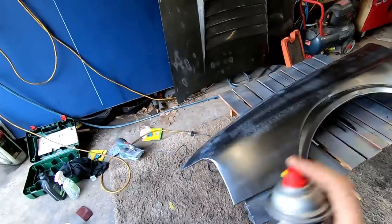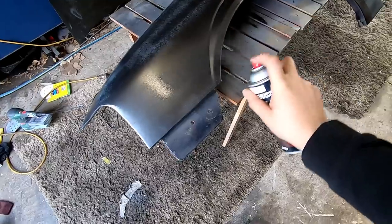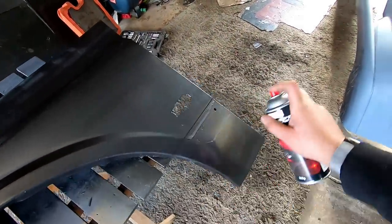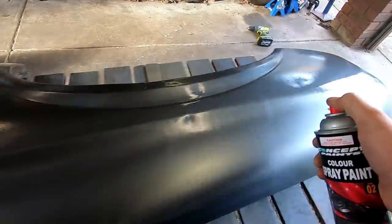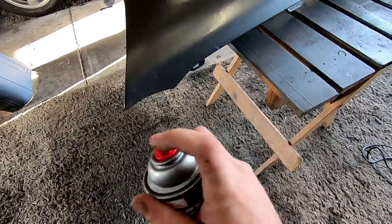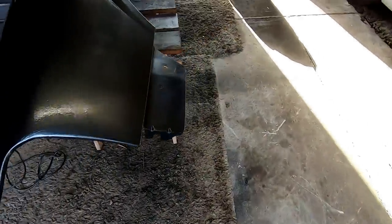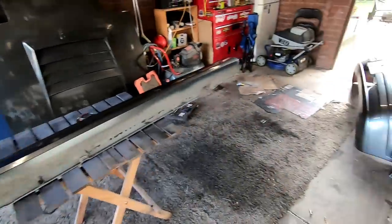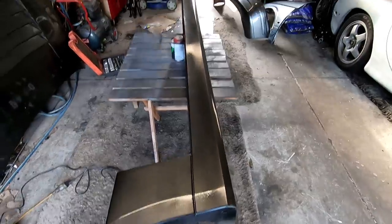It gets a bit windy which is annoying — I might get a bit of debris in the clear because of the wind, but oh well. I made this panel stand in like year seven. Using the can for the first time it sometimes comes out a bit quick. Now you don't want any runs in the base coat because you'll see them and you can't sand them out. Don't forget to go over all the edges. So once that dries, hopefully no tiger striping, and we'll hit that bumper. So I finished the guard, done the clear on the guard, done the bumper bar, done a clear on that too. And we've just done our last base coat on the skirt — letting that dry off and then I'm going to hit it with some clear. And then we're done for the front.